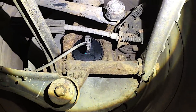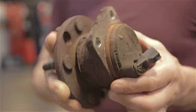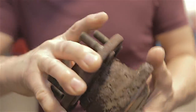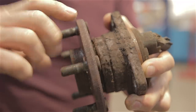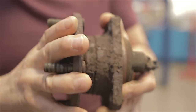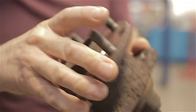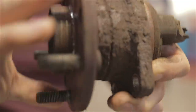The rear wheel bearings are forever going - they're not the best. Let me show you this bearing. I've changed many of these rear bearings over the years. They have an ABS sensor built in - they're a hub unit, you buy the complete unit. This particular bearing failed on the MOT - there is play in the flange, there's movement in the bearing. And if you try to spin it, you can't - it's notchy, notch notch notch. That is really quite bad, rough as anything.